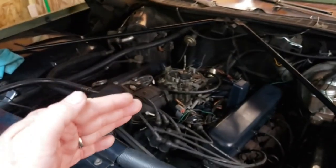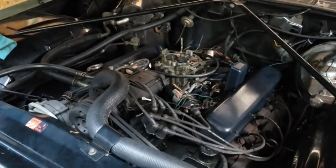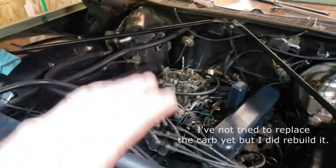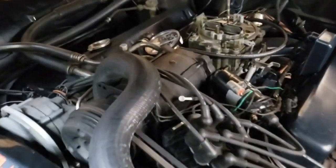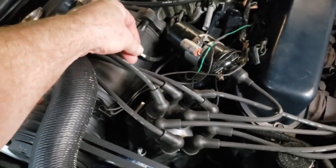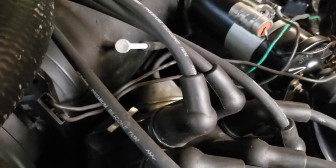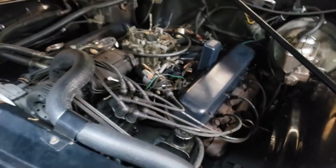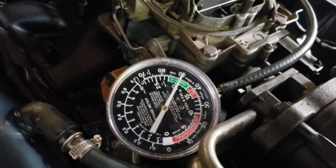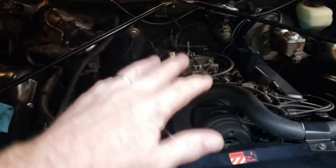I've tried to have manifold vacuum advance. Of course, setting the base timing there requires you to disconnect it first, correctly. Anyway, I think there's still a little something going on in the motor, but with all this tuning, we've kind of compensated for it. I still got a jiggle. You see my little golf tee there? This is my full manifold vacuum line. It's capped off. It's not dead smooth. Of course, you can see that in the vacuum gauge, right? Every time it jiggles back to 19, that's when you can feel it inside the car.